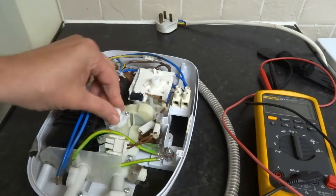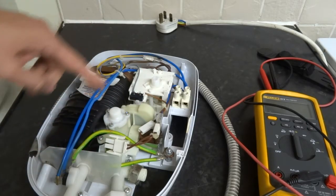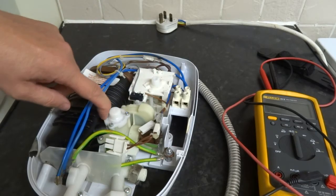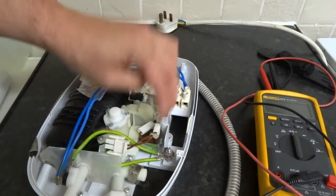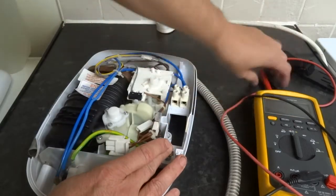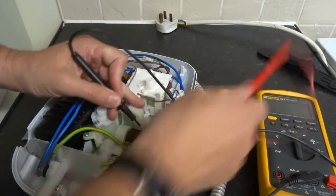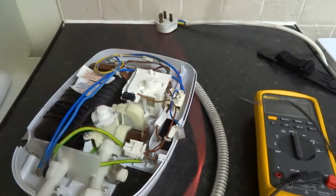Other problems that can occur are with your flow valve. This allows water through the heater and controls the flow of water, the length of time it's in there, and so how hot or cold it gets. This can cause problems like fluctuating hot and cold, or no flow. Built onto that is the solenoid. To test the solenoid, just test it for ohms — it should be about 3.4 kilohms, and this one is 3.6 kilohms, so that's good.